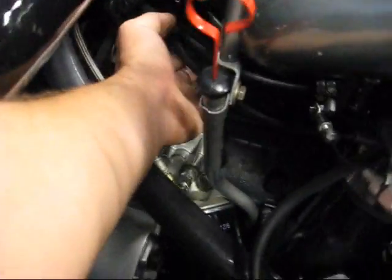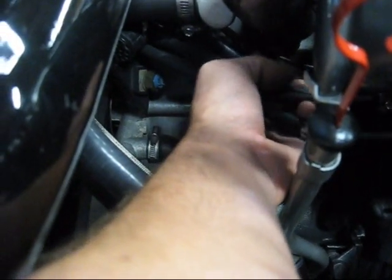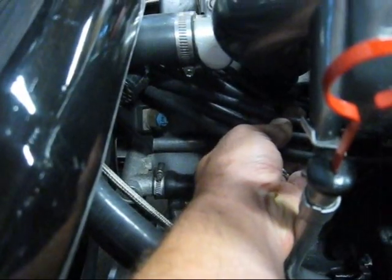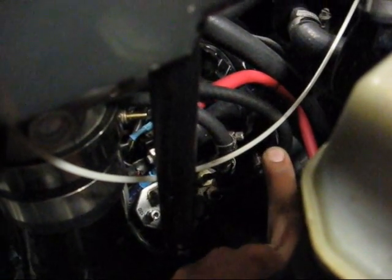Here's the other side. You can see all my fuel lines running. I also have some coolant lines to the turbo running through here. But I have a fuel line going to my cold start injector, fuel line to and from the warm-up regulator. I clipped the stock lines, shoved the rubber hose over top, and hose clamped them. On the high-pressure side, on the inlet, I have two hose clamps. I initially did this as a temporary setup out of necessity, and they're not leaking, so I've left them.